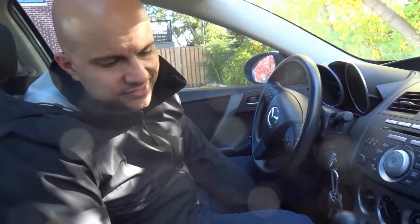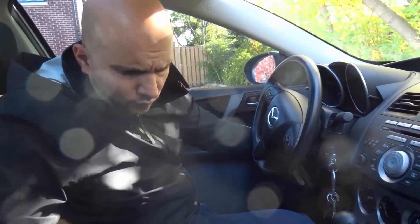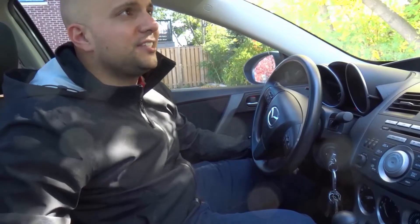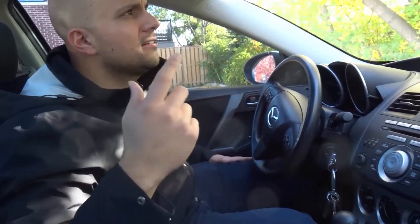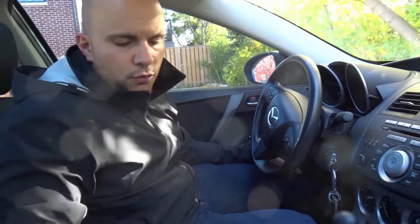Number one — you're going to use your senses. Number one is your hearing sense. You're going to listen for a squeaking, squealing, or even a screeching sound whenever you're pushing the brake pedal, which controls the brake pads. On your brake pads there's going to be a wear indicator — a tiny little piece of metal that causes a screeching sound to let you know that you should be changing your brake pads soon. It could also be something caught between the pad and the rotor, so you'll use the other indicators as well.